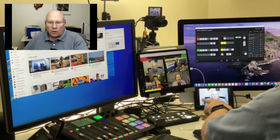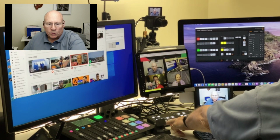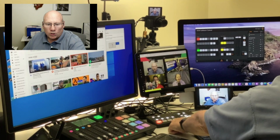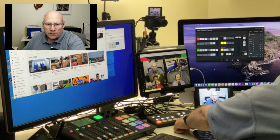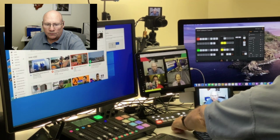To do the camera HDMI to computer USB, instead of using the Magwell that you were using before, you're using the ATEM Mini to do that. Right. A USB cable out of the back of the ATEM Mini. Camera one is the Sony. There's an HDMI cable from the Sony. Input one. Input two and three currently don't have anything hooked up to them. And input four is a second display on the Windows PC right now, which we'll do some stuff here in a little bit with. So you've got four video inputs on the ATEM Mini.